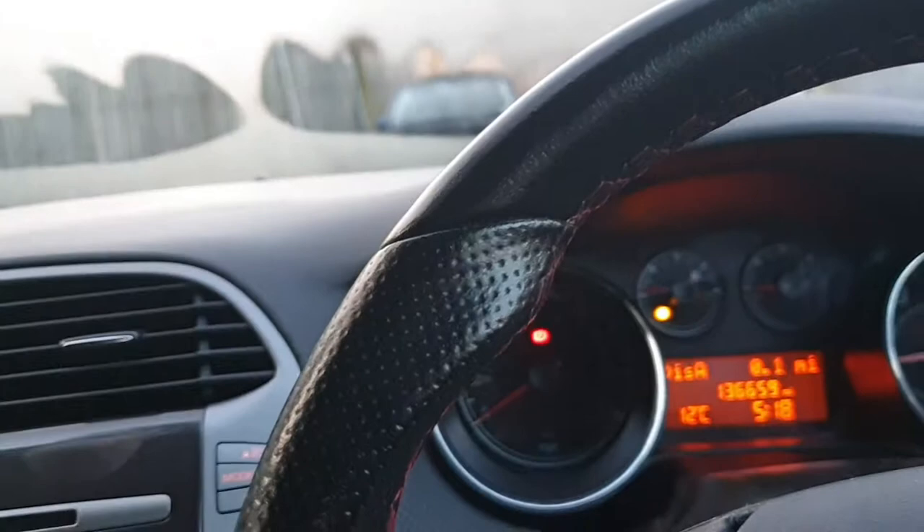So I've got to remove the wipers and the scuttle panel to manually open the flap, because I'm not going to try and replace the whole heater box just so I can open and close it. I'm just going to leave it open to stop the misting up, because this is ridiculous. But other than that, as I said, it's a completely solid car — just little minor things, really.